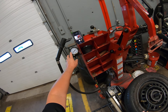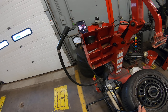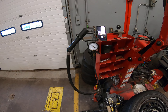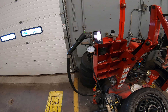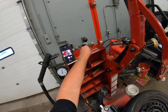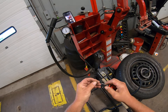Now we want to take this tire pressure up to about 30 to 35 pounds — right here on this gauge. Push down a little bit, and that clicking noise as it's pumping in air. Let off and the gauge tells us how much air is in there. Looks like right now we're at about 21 pounds... okay that's about 31, we'll go to 35 or so. Before you pull this off, you want to have your valve core ready to go back in, so grab your tool and your little stem and get them ready.